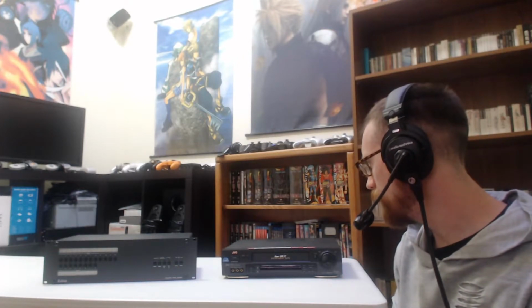So you can play on those and capture things off of them, but again, the colors are going to be off, and I guess it's overall better if you're going to do retro games to either do composite or S-Video rather than messing around with component, because then you kind of get into a realm of needing HD CRTs, which are really, really heavy and sometimes difficult to come by, and they're just not very practical, I guess.